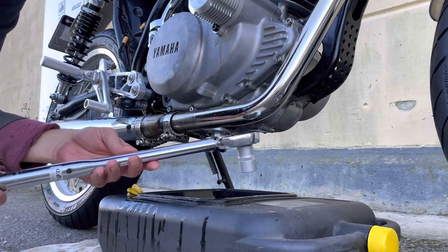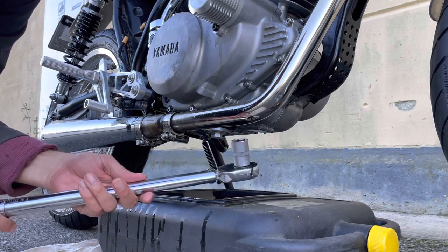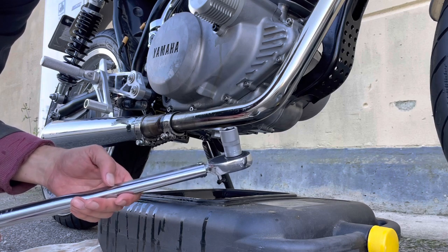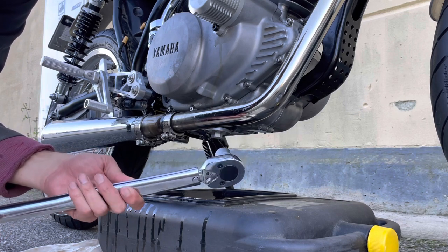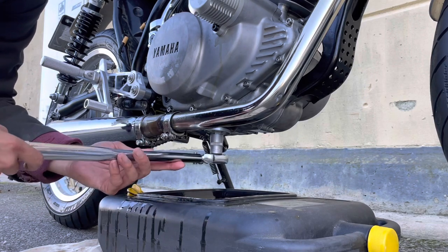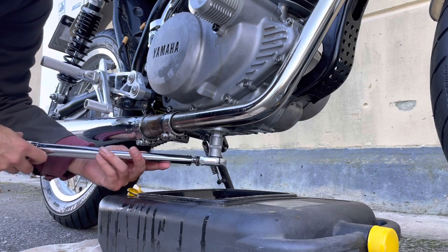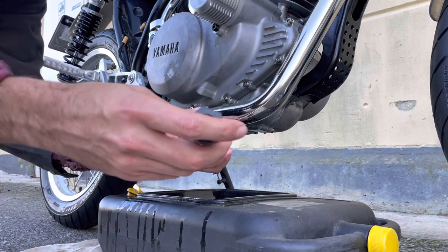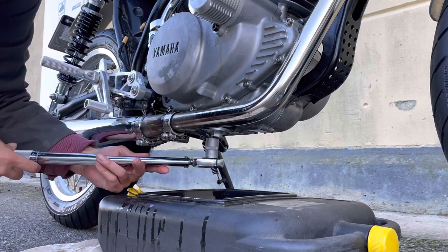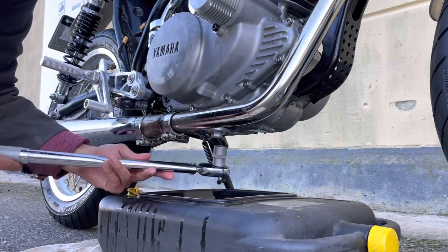So I really recommend anyone working on bikes at home get a torque wrench, and I'll post the values in the description of the video. But this is really important for doing this up correctly without stripping threads, because if you strip threads on this, it's almost irreparable. I mean, there's no helicoils in this size. You'd have to take it to a machinist, and it'll be an engine out of the frame job, and it's a nightmare.